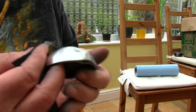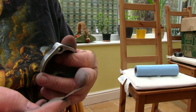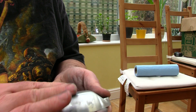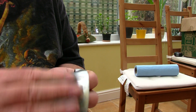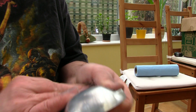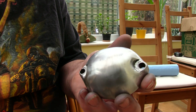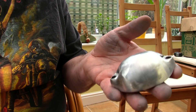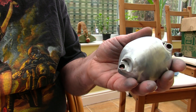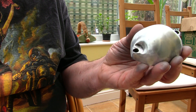So now we're up to 1500 grit paper and still with the dry technique. As long as you crosshatch it left to right you might see some lines in that, but when you clean it off those lines move around — they're just swirl marks from the paper. Once I've done plenty of dry polishing with this 1500 paper I'm going to move on to 2000 and finally 2500.